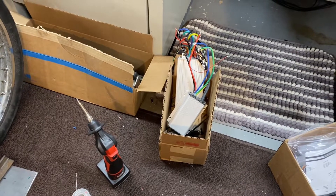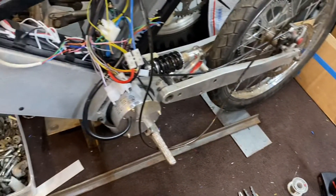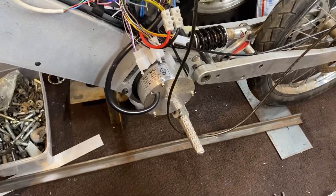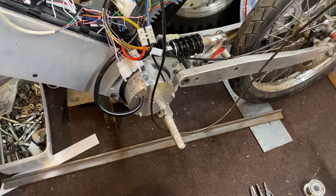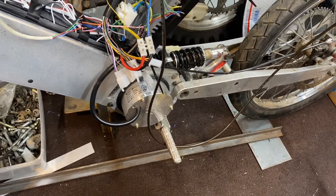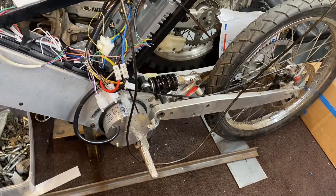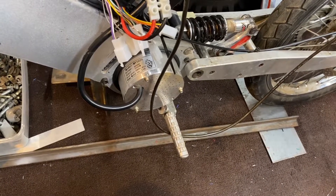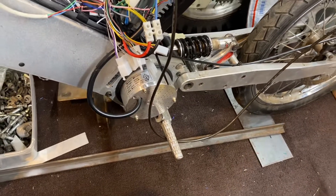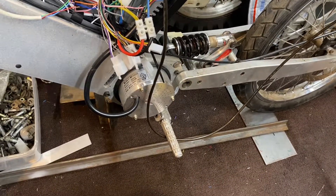In a perfect world I'd hope to get the Kelly controller going — it's the KBS72121X and I've used it on a bunch of other builds and really like it. Maybe I can go in and change the hall sensors; I do have a hub motor in my workshop that's fried and I could pull the hall sensors out of it, assuming they work. I'm not sure how to get this thing running right now, so I'm just throwing the feeler out there. Maybe other people have used this motor — I thought it was a Kanai motor, but I think these China companies just buy tons of them and throw their label on it. One person on Endless Sphere says every motor they buy is slightly different, so this one might just be bad.